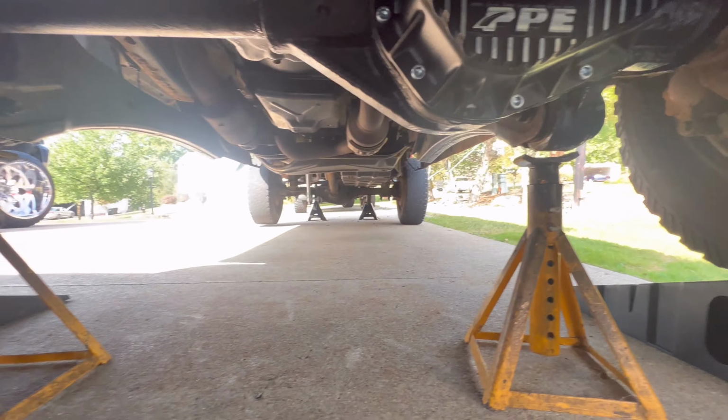Also, note, don't overtighten them bolts because there's an O-ring seal. So it's tight when it's tight. Just about 4 quarts for the front. I believe factory is like 2.9, so adding some more fluid, which is cool. So yeah, dialed in. All right, y'all.